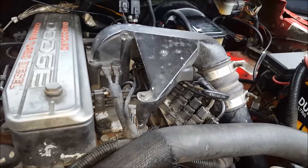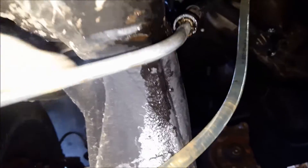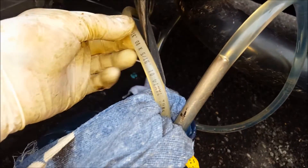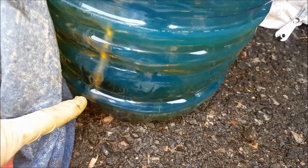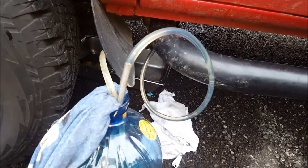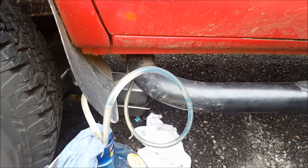So let's try to square this away. I used a three-eighths disconnect tool to get that line off, and I had a three-eighths aluminum line kicking around — put that in here and got it going into a bucket of diesel. I might have to reprime this system, but I fired it up and it primed itself no problem. There's plenty of air still coming through there, but I'm going to let this thing run. Make sure you have your inlet side all the way at the bottom of the bucket. If all that air clears out after running for a few minutes, then we know our problem is within the fuel tank, and I'll drop that tank down.